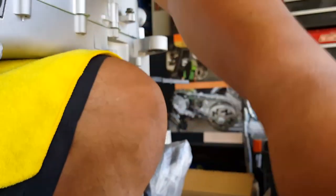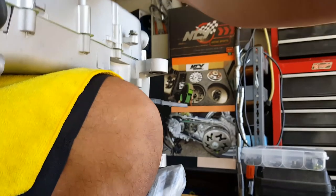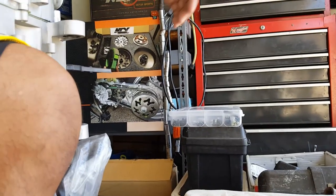So all we did was gave it a jiggle. We didn't really have to hammer anything in or anything like that. We just kind of pretty much rocked it a little bit to force that secondary kickstarter stud there to fall into its proper slot, as well as move things around in this whole mechanism that we cannot see, to be able to secure itself. So now what we're going to do is go ahead and prep up all the bolts. We're going to torque it down to five foot pound specs.